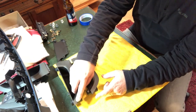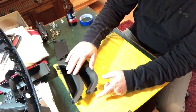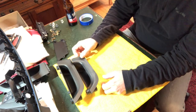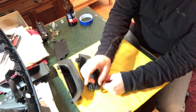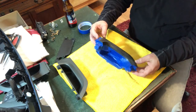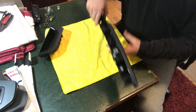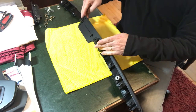We had experimented with vinyl wrapping — these are very hard to wrap as they've got a pretty decent vinyl coating on them. So I'm going to try something different with this one. It wasn't in that bad a shape — mostly scratched on the surface — so we're going to try to just repaint the top layer. I prepped a piece by scuffing it with a Scotch-Brite pad and then masking off the areas. We actually applied two coats of plastic primer and two coats of black satin paint to reach this point.